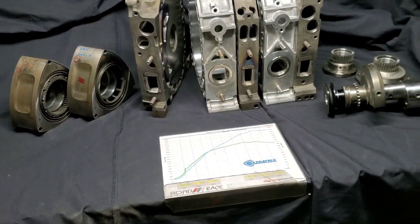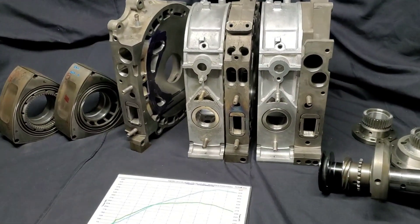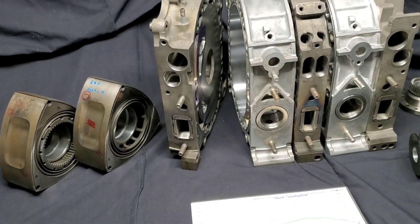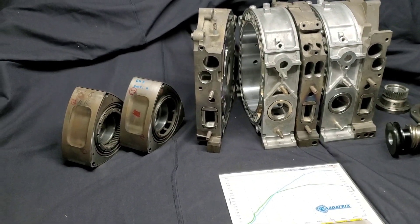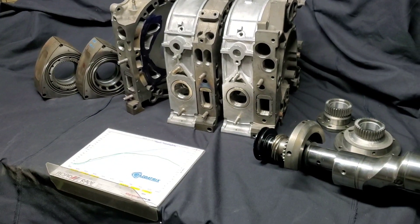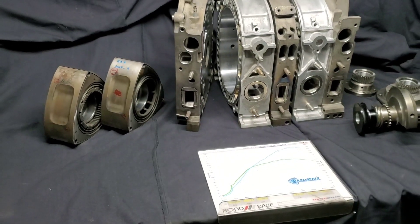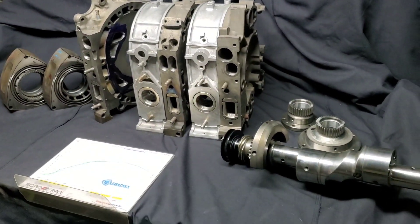The beam strength just isn't there, and I think that might have been one of the big issues. Another question I get a lot is: will it work with an OEM ECU? I just don't know. Mazda ECUs are not known for their flexibility. So in most cases when I recommend performance rotary builds, one of the first things I recommend is get a new ECU for your car — they're really not that expensive when you talk about the thousands of dollars you put into the motor. I like Haltech, but something that allows you timing and fuel adjustability for a performance build, especially if this motor is not going in an RX-8 — if it's going in a hot rod, an RX-7, some off-road purpose car, race car — then there's really no reason to use that OEM RX-8 ECU, which has a lot of restrictions and constrictions to it.